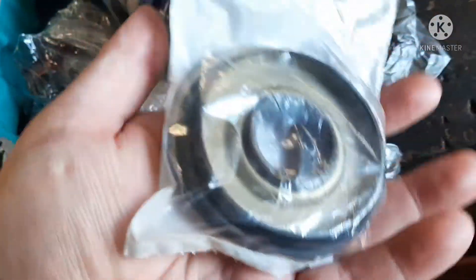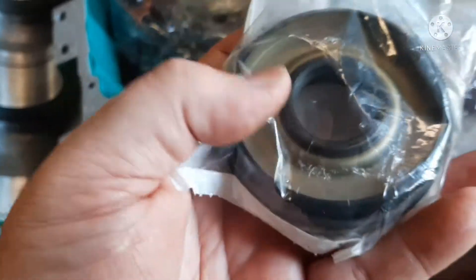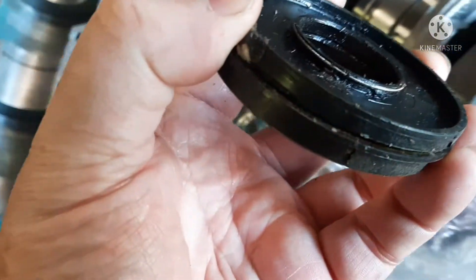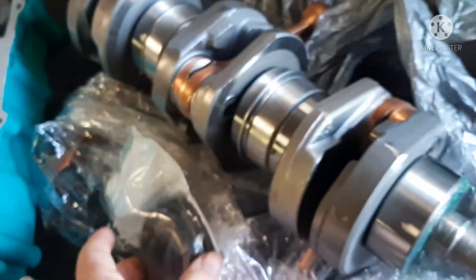The two-stroke will lube the other ones for you, but I always put marine grease in these on each end. Then you've got to build your seals — the two that face each other — and the grease goes in between. This is the front, this is the back. The back is a double seal — it's the larger two seals — and you fill it with grease.